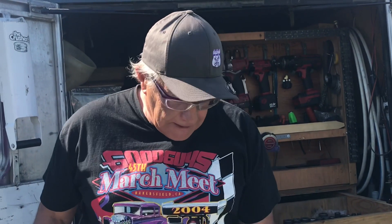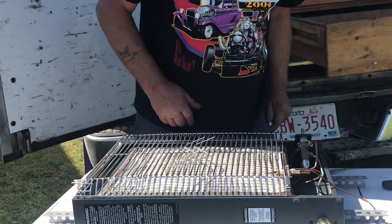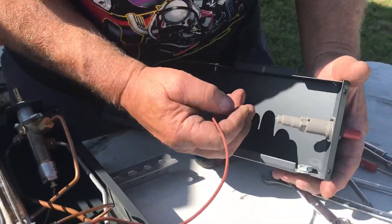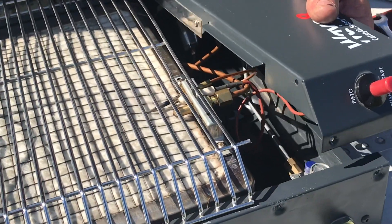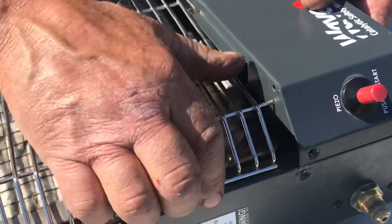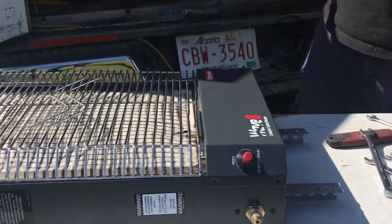The screws we use are the ones that hold the mat into the plate, so it all pulls together. I don't want to take that apart because I don't want to mess with the mat. To reassemble: put the mesh screen on first, set that down, then get your control panel. Don't be dumb and hold your hand there when you hit the igniter — you'll get a little shock. Then put that back in, over the valve like that, lift it up, put the little feet in, and push it down. Then put the screws in.